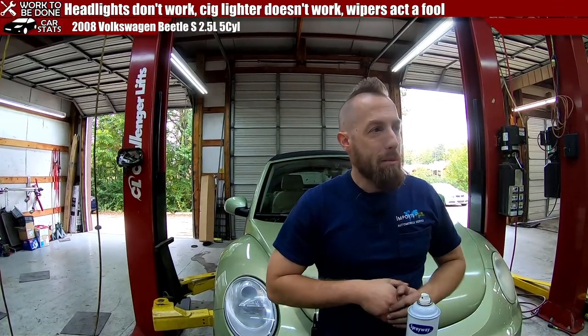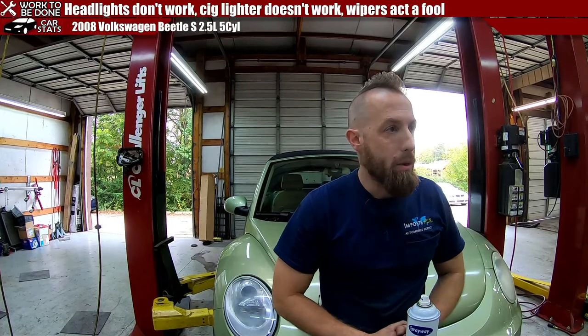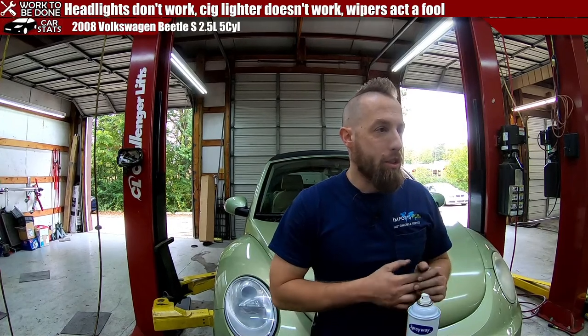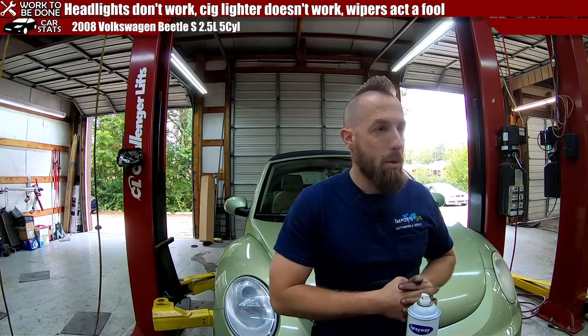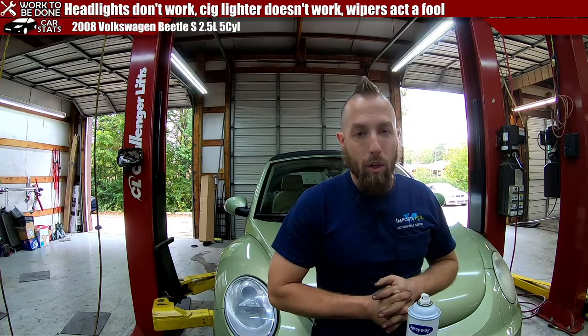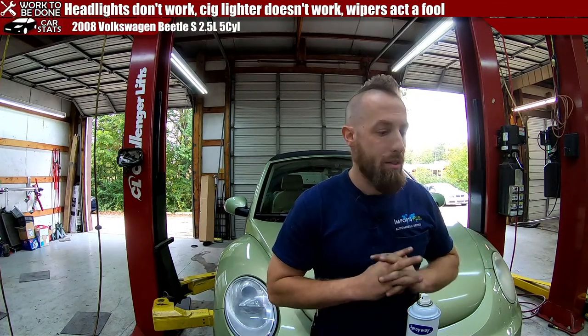There. Disassembled the wiper system. The cowling area was full of leaves and debris. Cleaned up junk and started testing. We had voltage on the wires and I powered the motor itself and it worked fine. Conclusion, the debris was so full and wet it was shorting out the exposed motor connections, thusly not allowing the wipers to work. It works well now. Stop parking under a tree.